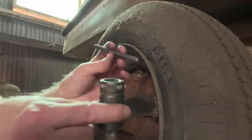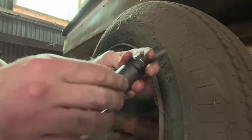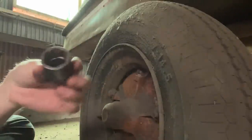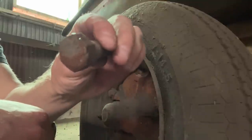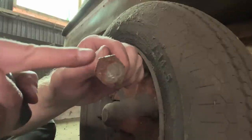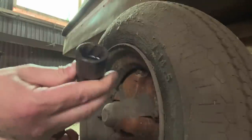To get the bolt back out of the extractor, the set comes with a push pin that you put down into the hollow socket hole — hold the bit and hammer-tap it. There you go, popped right out. You can see the little tooth marks glinting where it bit in, but notice it was not on the actual ridges so it didn't deform them any worse. Not a lot of damage to the bolt head either — very effective, especially with the breaker bar.